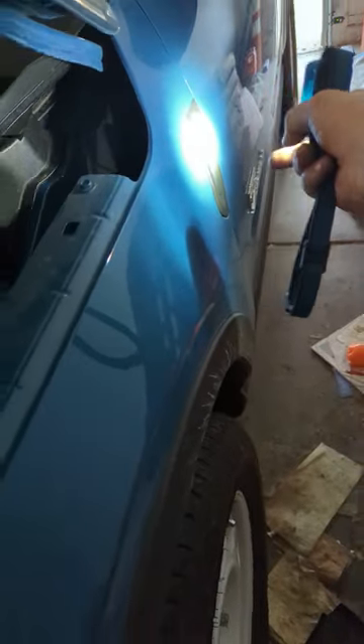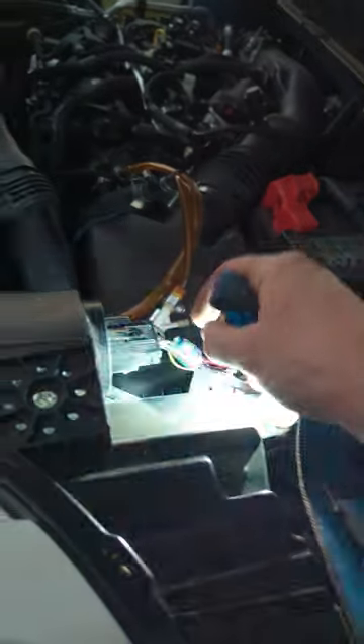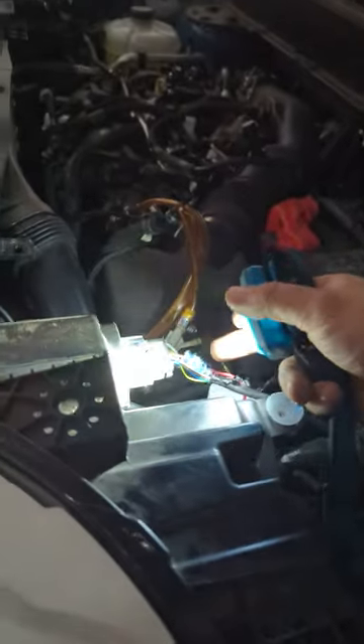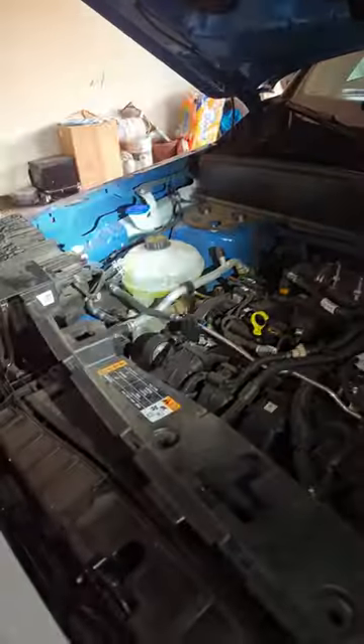For the power, I copied what the marker and turn lights use — they get their power from a wire with a big brown stripe and a small blue stripe going to the headlights. I've never done this before and I don't like these little crimp-on attachments, so I added some super glue around it — first thinking I could make it waterproof, then just to make sure the clip doesn't come loose and lose the power connection. I only had to do that on one headlight.